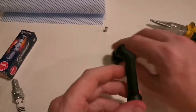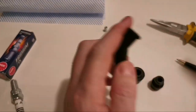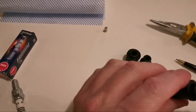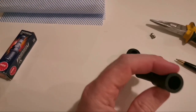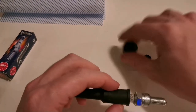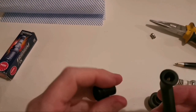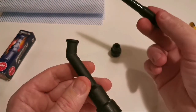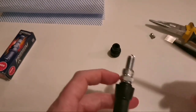I'm not necessarily recommending you go taking this off your bike, but I did this for educational purposes. You can actually buy these online for about ten pounds or less. I'm not sure why you'd buy this without the entire HT lead, but I guess it could be damaged. Basically, this is where your plug goes into - that's why you want to take this off, because it won't fit in the connector otherwise. It just slots in there, and with this rubber boot on it holds it nice and tight. It essentially screws straight into the copper HT lead, and a higher quality HT lead means less resistance in the cable, less draw on your battery, less draw on your starter, and a cleaner spark.